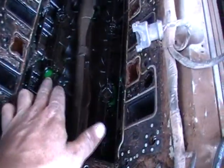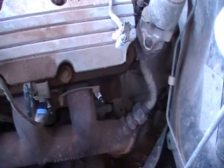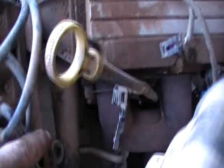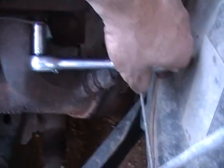And that's the first thing you see when you take the inlet manifold off — there's a bit of coolant here and a near-blocked water inlet. When you come into your heads, drop your exhaust off first — just a couple of 13mm bolts on your exhaust manifold. Now that the coil packs are out of the road, it's a bit easier to get into it.